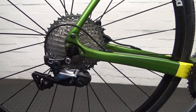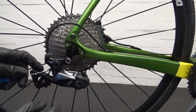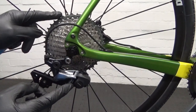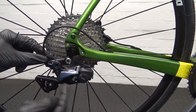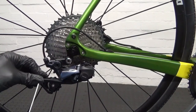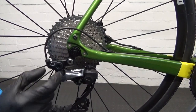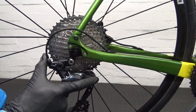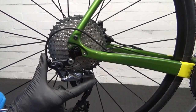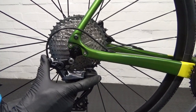Now what you need to do is use your 2mm hex head and locate your B screw — your B adjustment screw. So because it had an 11-32 on it before and now this is 11-40, what you need to do is hold the derailleur up so the B screw is actually touching the stop. Like so. We've got the clutch switched off doing this — just push down on the cage and still touching here at all times, then push across.